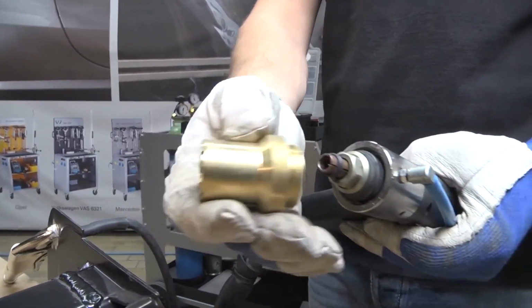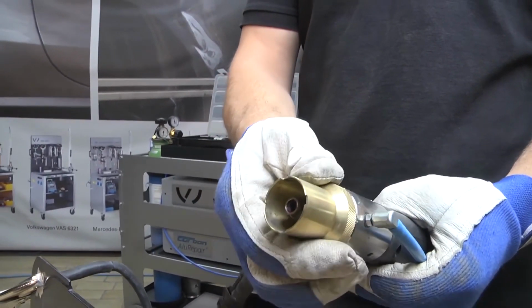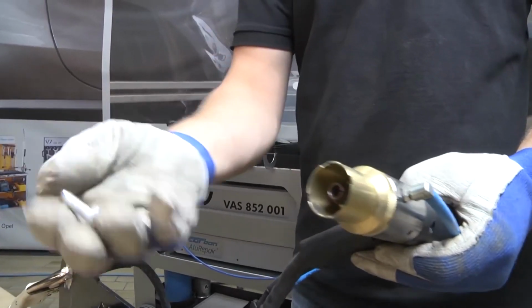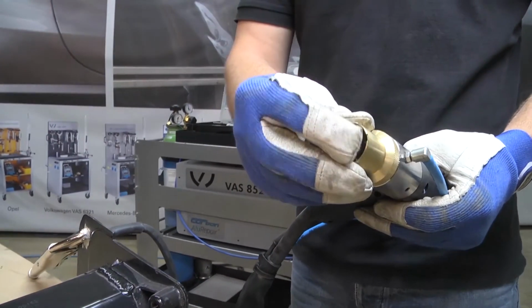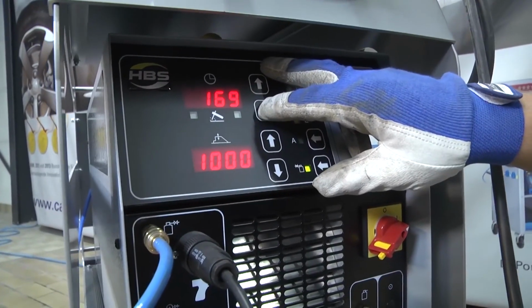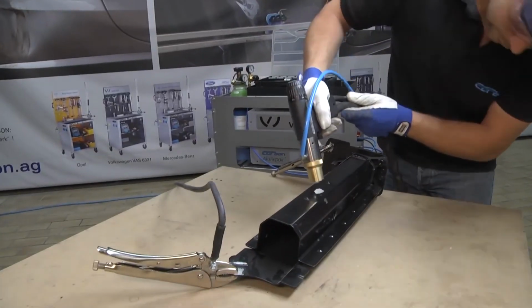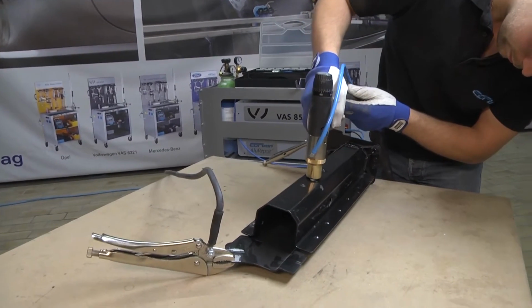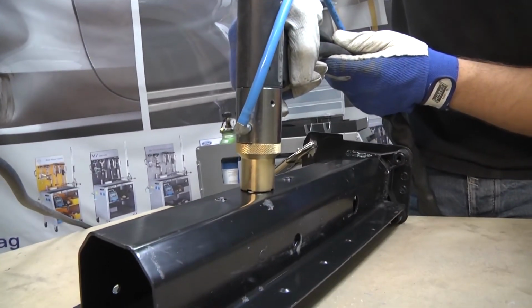Next we will show you how to weld an 8 mm aluminum ground bolt to the component. To do this, we have removed the paintwork and dust from the surface to which we want to weld ground bolts. Adjust the chuck by switching to using the ground bolt attachment. Now set the correct program on the power unit and push the ground bolt into the chuck. Here too, the chuck needs to be positioned with care and pressure applied when welding the ground bolt.